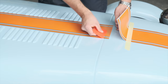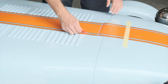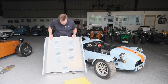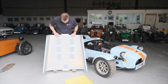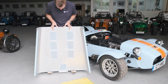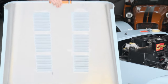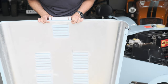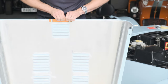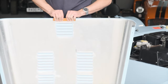From initial inspection you should find that when you release the bonnet section, the nose section should still line up. Now that the bonnet's in hand, place it on your toes so the stripe at the bottom doesn't end up on the floor, and neatly fold the leftover piece of stripe over the lip of the bonnet. Stick it to the underside. Then turn your bonnet over again, placing it on your toes, and do the same at the other side. Make sure the underside of your bonnet is clean in the contact areas to ensure it stays stuck.